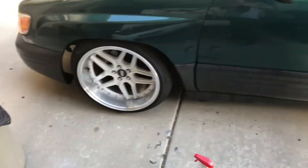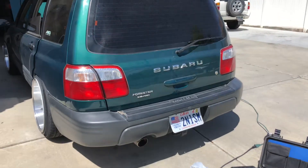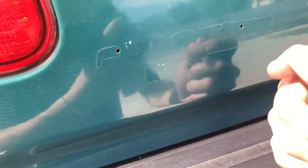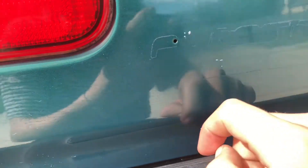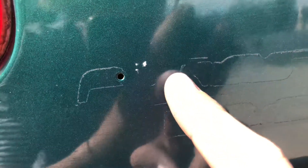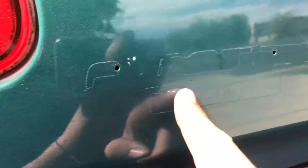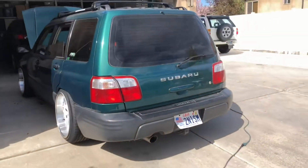My phone shut off because it got too hot, but we've got the passenger side done and this side is pretty much done too. I'm just about to take the back emblem off so my phone doesn't overheat again in the sun. Here's before, and that's after. It looks like I'm going to need one of those plastic sticker scrapers — an X-Acto type scraper — to get the rest of the residue off the edges. It also looks like it pulled some paint, which I can touch up with a paint pen. Goo gone and a rag alone isn't getting these edges clean, but I can do that later. And there are also holes left where it said Forester, which I forgot about — so I'll need to get little rubber pins to fill those.